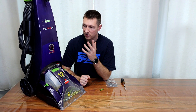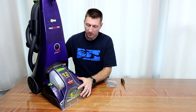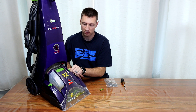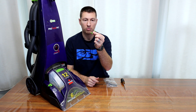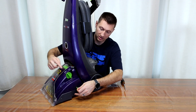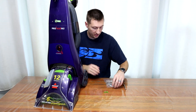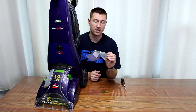This is one that does pets and it has heated on it. Here's the repair: when we want to go from floor cleaning to tools, there's a flap right here that should move up and down when this knob is turning. It's not moving up and down. We found out the culprit is this piece of plastic that broke off inside the machine. This is what connects the knob to the flap, and this broke off. Fortunately, we were able to find a replacement part for just a couple of dollars. I'll show you how to do that in this video.